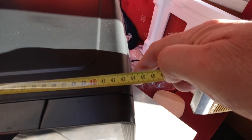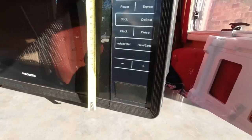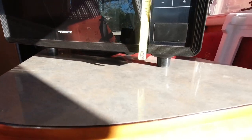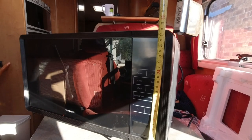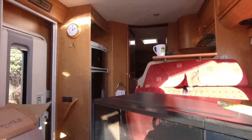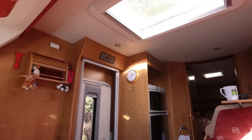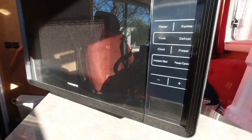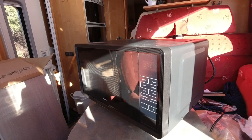Width is 44 centimetres. Height of the microwave oven fascia is 24 centimetres, but it has quite tall rubber feet and a good bulge underneath, so your overall height including those feet is 28 centimetres — advertised as 27. That's quite relevant given the gap we've got. I can make the hole as tall as I like by cutting the panel at the top, but I don't really want to. I want to keep the van as original as possible and be able to reverse anything I do. The extra height is slightly problematical, but we will get around it. Dimensions are the number one thing that makes a microwave suitable for a motor caravan.